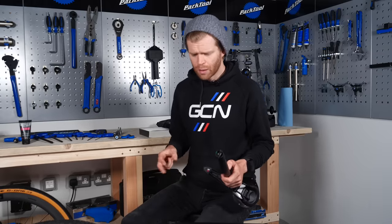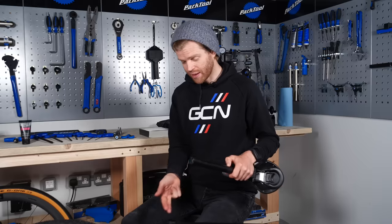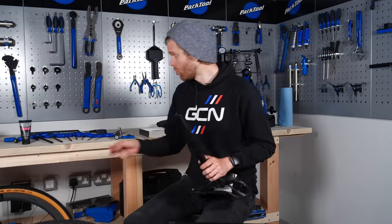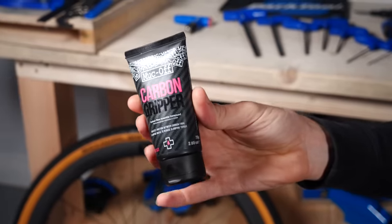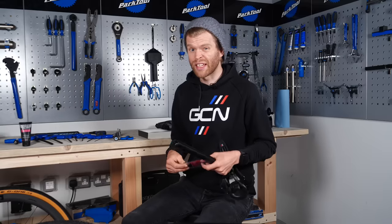We're next going to insert the seat post, but before you do, you should prime it. If your bike is made from alloy — an alloy post and an alloy frame — then you should use regular grease. If either component is made from carbon fiber, you should use carbon assembly paste or something like a carbon gripper. This bike happens to come with a small sachet of assembly paste, which is very useful, but if yours doesn't and you don't own any grease or carbon assembly paste, I'd recommend buying some — it's not expensive and regularly comes in handy.